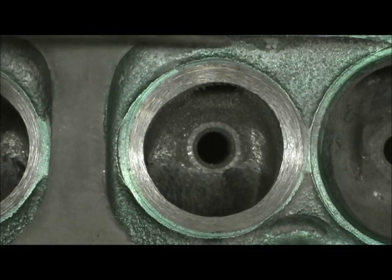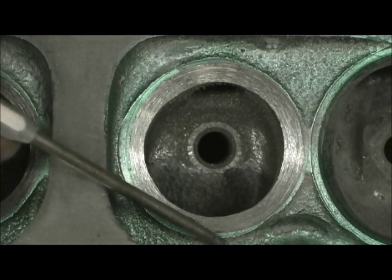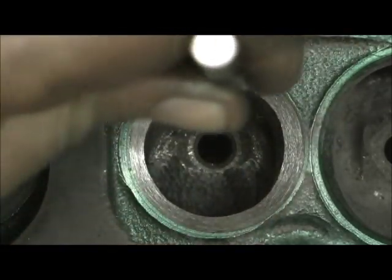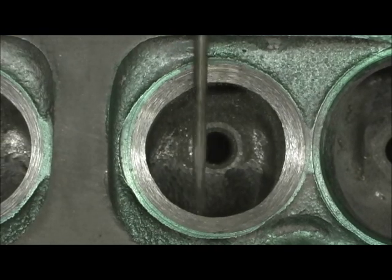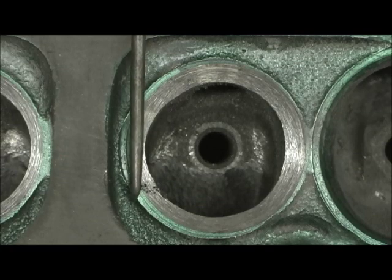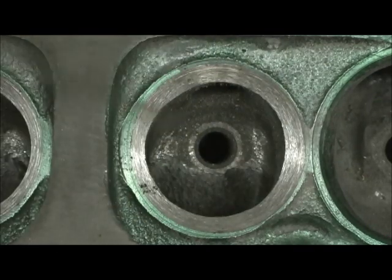No air is getting right there — the air has to get here, then it comes up into the 60-degree and bleeds off into that valve. That is the hole that the airflow is seeing. Putting that great big 1.60 valve in there is doing almost nothing. You'd think there might be a little venturi effect, but not much. And look how close to the wall that 1.60 valve has moved — it's in the same predicament as the 2.02 was, shutting off flow against the wall.